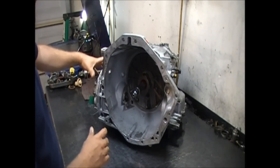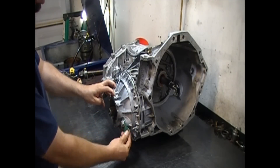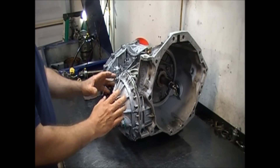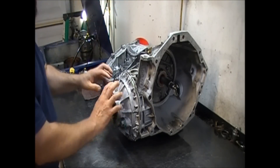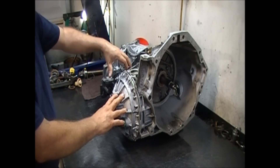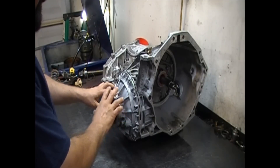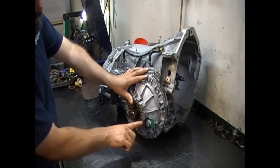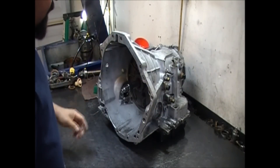We're going to lose a little bit of gear oil — it takes separate gear oil here on the side, and there's a tag that says it takes 80-90 weight. If you do one of these units and you fill the transmission up with transmission fluid but forget to fill this with gear oil, you're going to destroy the differential and the case as well. Make sure you fill this up with gear oil. The fill plug right here is also your level — just like any differential.